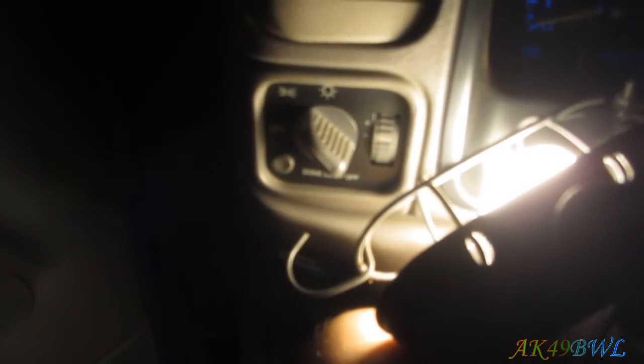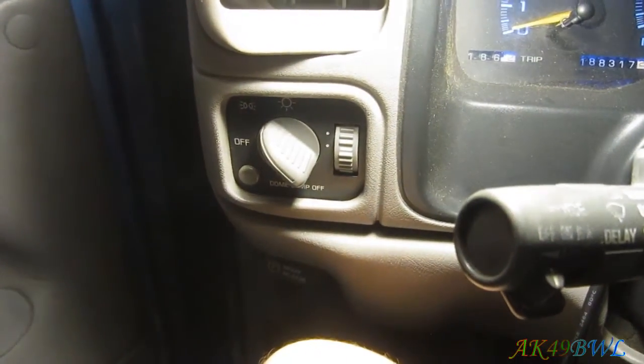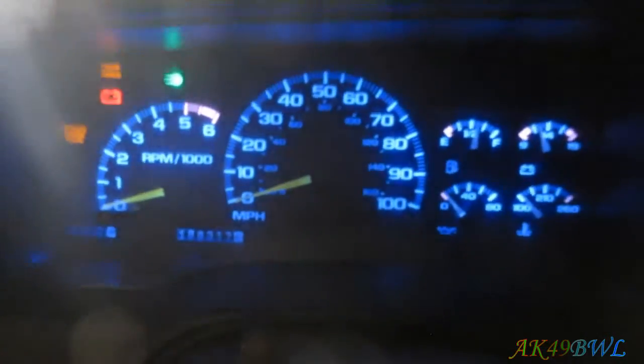So now the only thing left in here to do is this headlight switch right here. Oh, and that one's going to be very interesting because the bulb gets its power straight from the housing. So we're gonna have to figure that one out. I got all these done. Got these done now. The radio's been done since I did that in the Blazer in 2007 or 8. I gotta pull the HVAC cluster 74 bulbs out and replace them again because the super bright LED 74s don't like to work for very long.